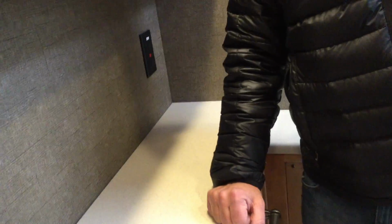So you have the GFI breaker in the bedroom bathroom. If your wall outlets aren't working throughout the coach, check this first. It usually means someone was cooking on the microwave and someone was doing their hair at the same time. We know all about them. I pop it all the time now because of Christmas lights.